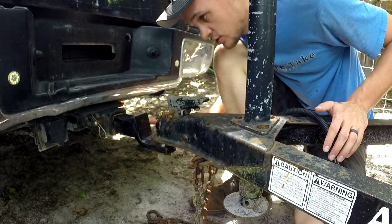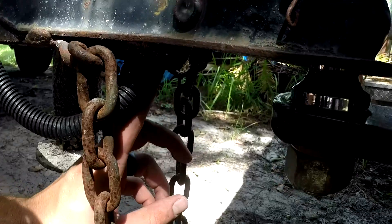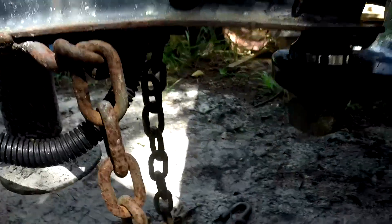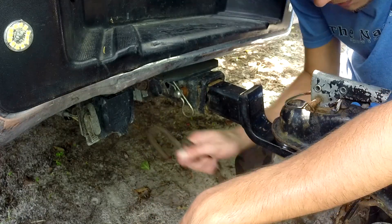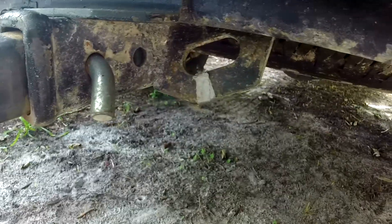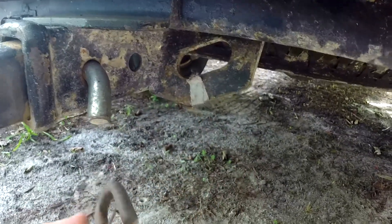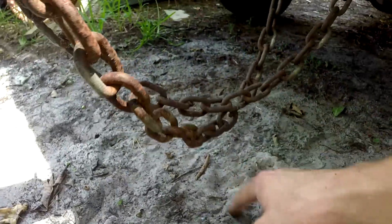Now that the jack is in place, go ahead and secure the chains to the truck. On my trailer, the chains are on either side, which is the best design. Some trailers have both chains attached in the middle, but I much prefer one chain on each side. Here's why: instead of taking the left chain to the left side, you take the right chain and hook it to the left side, and take the left chain and hook it to the right side. That creates an X in the chains, which will catch the trailer should it come off the ball. The tongue will land right in that basket and reduce the chances of it scraping the ground.